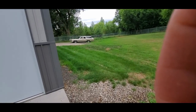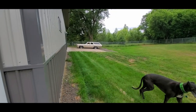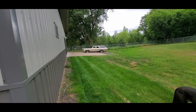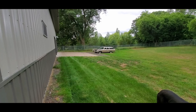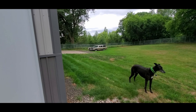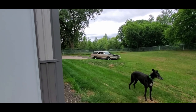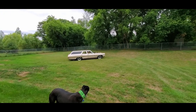Okay. Oh, I can see my finger. Let's move that. Come here, Ollie. Yeah, it's still a little bouncy. We're going to want to set those shocks. We have no idea what they had them set at. Yeah, you can hear them grabbing. So we think the driver's front grabs a little bit. So we're curious about a brake hose issue or a bleed back issue, but we'll get there. Yeah, at a decent ride height, that sure looks nice.